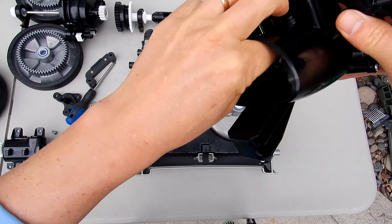On the bottom are the cyclonic turbines. To change these, simply move this arrow and line it up with this arrow here, then stick the screwdriver in here — there's one Phillips screw, just unscrew it. The cyclonic turbine should pull right up and out. These are very easy to replace. To put it back in, slide it back in, line the arrows up, and tighten up the screw.